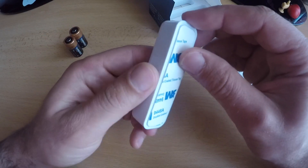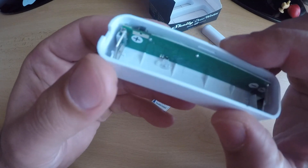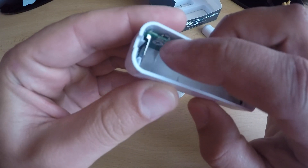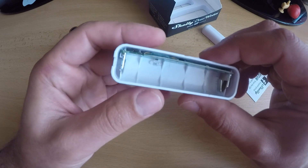Inside the biggest part you have to insert the batteries. I had some difficulties finding the exact model of the required batteries. Just don't confuse CR123A with CR23A — they are quite different. This is the reset button; if you hold it for more than 10 seconds, the sensor will reset to factory settings. I had some issues pairing this device during the last step, but maybe my Wi-Fi is to blame. I made a hotspot from my phone and that did the trick.